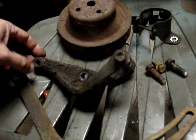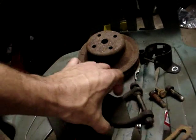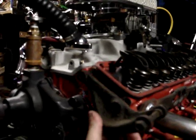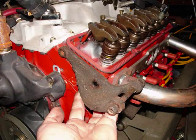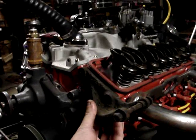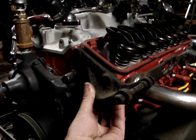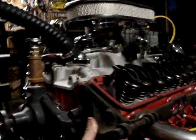I'm looking at it again and I'm going, I know what that is — Don's got one of these on his 55, has no idea what it came off. This actually goes right here, and it puts the alternator outboard on a cast iron bracket on its own. That's what I'm going to use — no flag bracket, no over-the-engine bracket. The alternator will stick out a little bit, but not a whole hell of a lot.